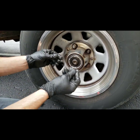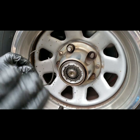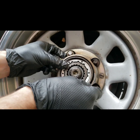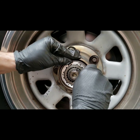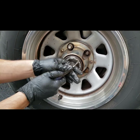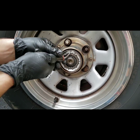The next and final step of the inner hub assembly is this outer ring. Here's your housing and then your new hub. This ring fits on the outside of the silver part, so push it in there and keep working it around. Push it all the way in, then use a flathead screwdriver to fully seat it — it clicks. Just make sure it's seated all the way around and fit into its groove.